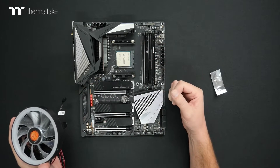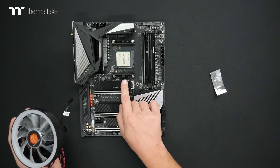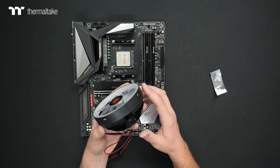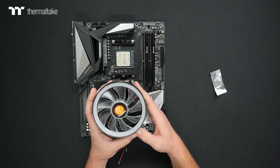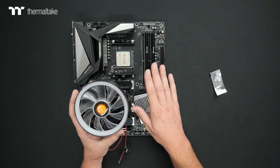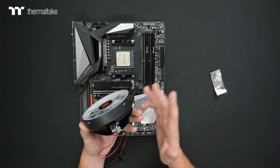For this motherboard configuration, I'm going to want my push-tab on this side so I have enough room to make it easier to install, versus having to reach over to the other side. Also worth mentioning, the UX100 is a low-profile cooler, so it does require clearance for memory up to 33.8 millimeters, or about 1.3 inches in height. Watch out for taller RGB memory when purchasing a cooler with this low-profile design.